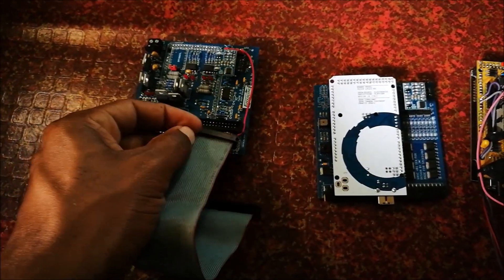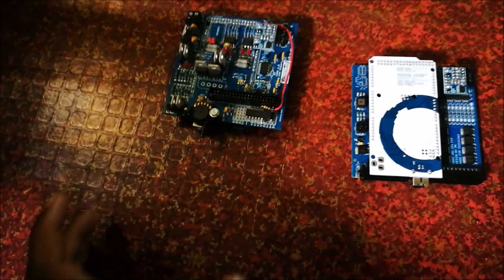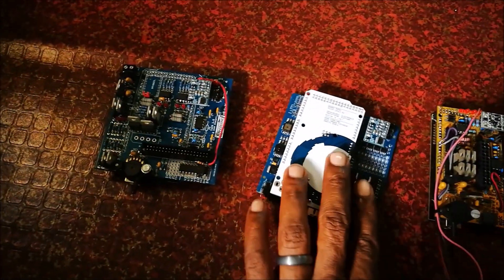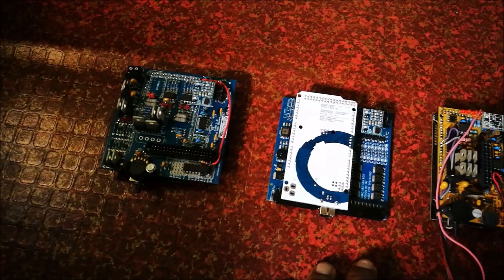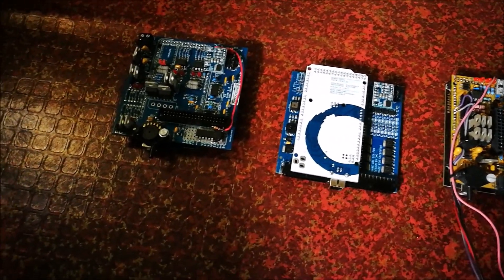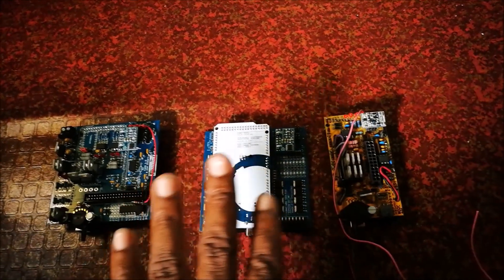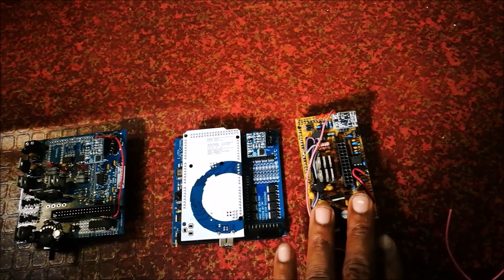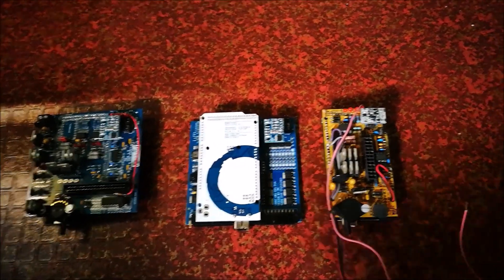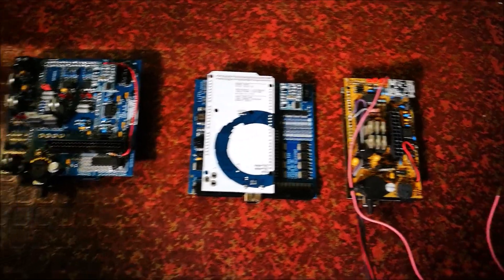You can break out the wires directly from the board to the factory ECU connectors. If you're doing a complete rewiring, I'd recommend the UA4C since it will be an external ECU and you build your patch harness externally to go to your car. The NO2C I'd recommend for a four-cylinder or two-cylinder motorcycle where you want something smaller — or if batch fire is fine for you and you don't need sequential.